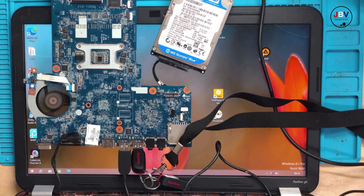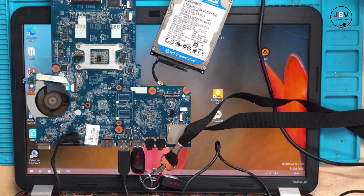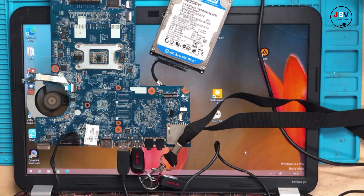I can see the USB is working, guys — I'm so happy, although I didn't do anything. There was a lesson to learn here: you saw how I was diagnosing the USB port — I checked if they were receiving 5 volts, and they were. This means the fault was being shorted somewhere in the chassis or by one of the components. Anyway guys, this is it — stay tuned, I'm going to keep teaching you more and more stuff. Go ahead, press the subscribe button and don't forget to like the video!